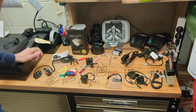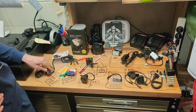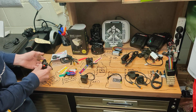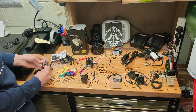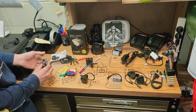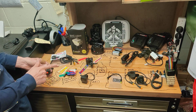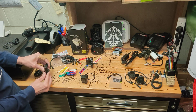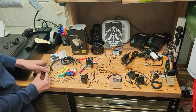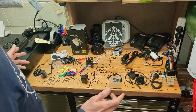A few people on some of the Facebook groups suggested that they have tried other switches and they've come to the conclusion this is the one. There is another one I saw here which has a 3-position light, off, parkers and driving lights, I guess. And then this is just a low and high beam. That particular switch has a slider, but this is a rocker. There's a slider left and right, whereas this one pivots. So I think this is the better, more relaxed, more positive way of switching than the slider. So yeah, that's about it. I don't think there's anything else to add.